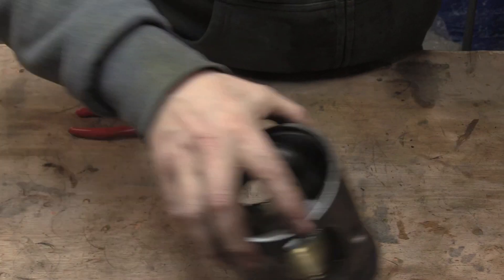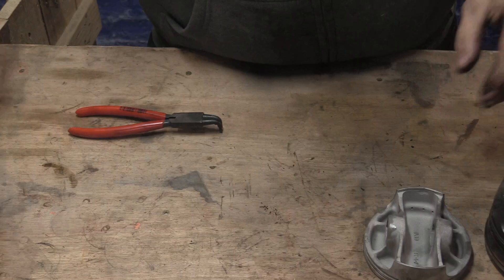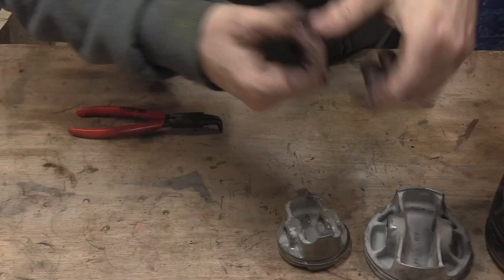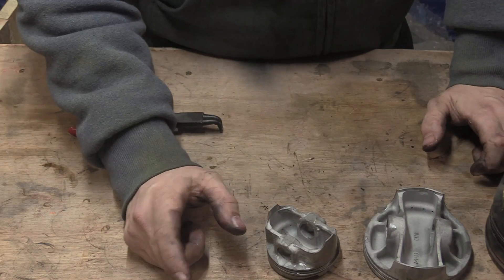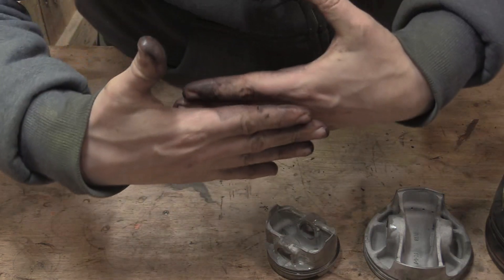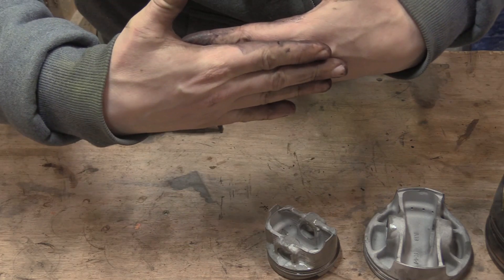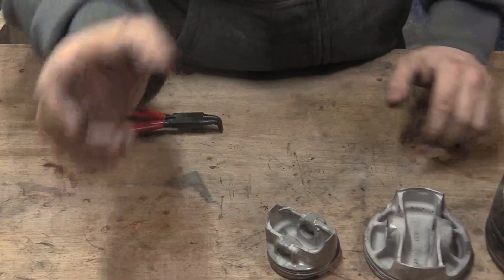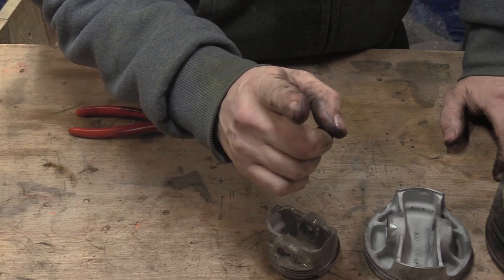Can you do it with this method with big rings? Yep. Can you do it with baby rings? Yeah. With intermediate sizes? Yes. It's all about technique. Instead of trying to fight it with your fingers, you use the open span of the ring to your advantage. Come in at a slight angle instead of perpendicular — ever so slight — and as soon as you get that ring started, the bore as you push down will slowly close up the ring and in she goes. Hope that makes sense, and I'll see you in a bit.